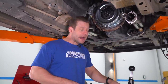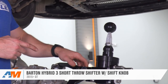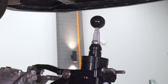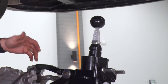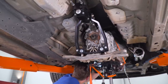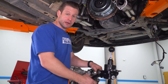We also did one of my favorite modifications for any manual car — the Barton Hybrid 3 Short Shifter. I absolutely love this thing; I have it installed in my S197 and it totally transformed my driving experience. We went with the flat stick with a cool look, topped off with Barton's black knob. We also have one more part from the Driveshaft Shop — a lightweight aluminum driveshaft. We have to muscle this transmission back into the engine first, then we can put it on that driveshaft and start having some more fun with other mods around the car.